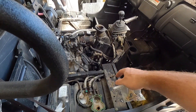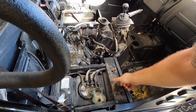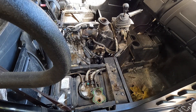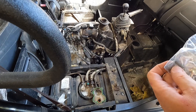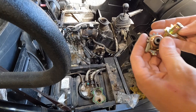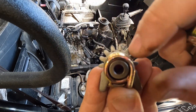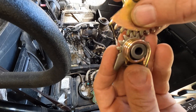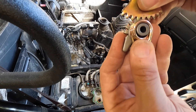Let's open this bag. This shift linkage piece is easy to come out - just pull it out, that's a 10 millimeter bolt. Let me show you the new one and the dots. Hopefully the dots are on the new ones because sometimes they don't come with them. You can see there's a top dot and two dots on the bottom. It's got a dot here, a dot there, and this gear also has a dot - those dots will line up and that puts it in the neutral position.